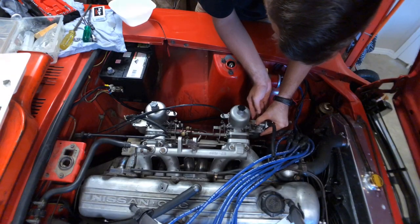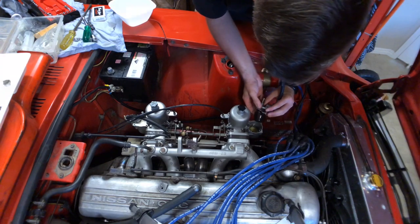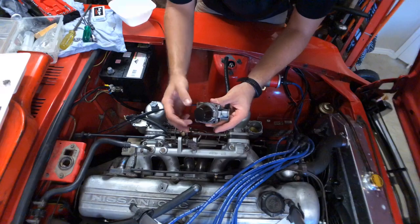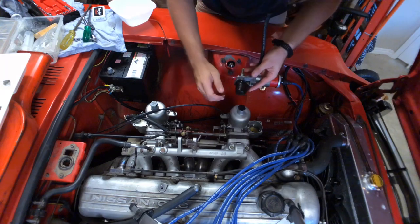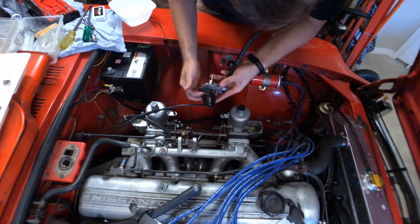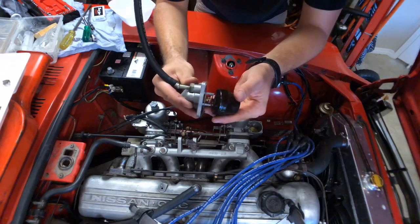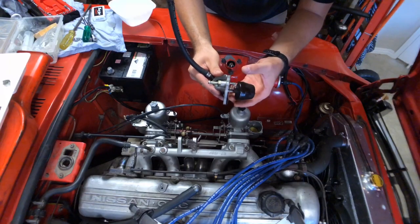These are the fuel floats. I do have a bit of fuel in here I'll have to drain. I use cork gaskets which came with the Z-Therapy kit — you can see the float there. These are the round-top SUs for the early model 240Z, so the floats do vary a bit. You can see the jet in there. There's a little tab that touches on the jet that alters the float. Also be careful — the fulcrum pin that holds the fuel float in is not held in by anything except the case body, so it can fall out at any time.